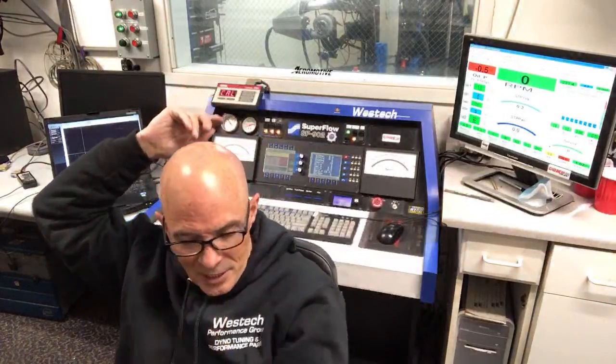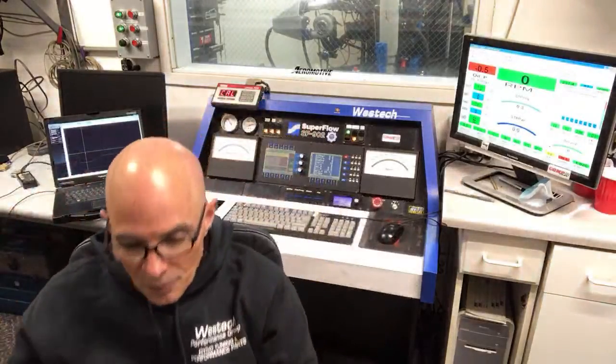Casey, the 3800 has a metric bell housing that's similar to other V6s. I think Tim's got a list up there. Heads, cam, intake, yo. Yeah, there's nothing wrong with this motor. It's just that I have to cap that PCV deal. There are adapters for the 3800 to go to conventional transmissions, Turbo 350, Turbo 400, that kind of stuff.